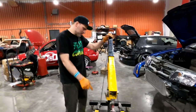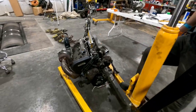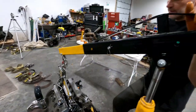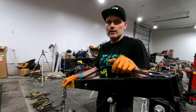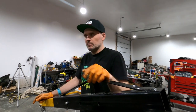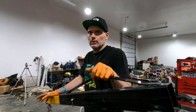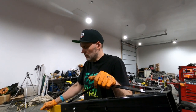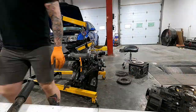We got it all timed up. Got the fluid damper on there. Covers are all on, mounts on, and pans on obviously. We're just about to put the clutch and transmission on and put it in the car. Clutch is an FX400, and it's a six-speed obviously because it's a GLI. No diff — he talked about it, but this is obviously a pricey endeavor as is. One step at a time. Let's do it, Clayton — set the camera up and we'll put this on.